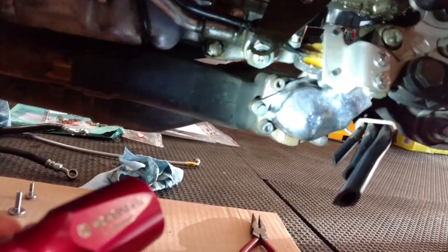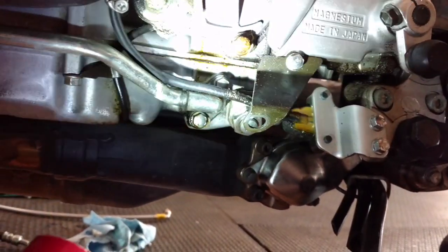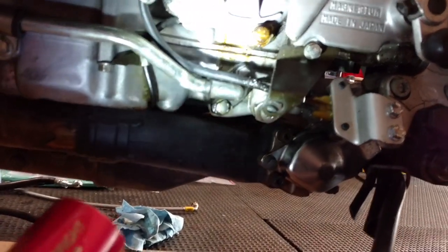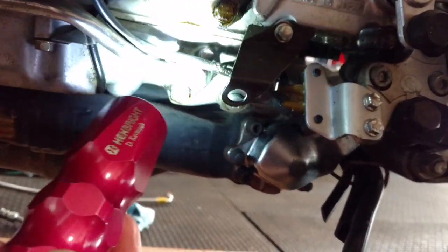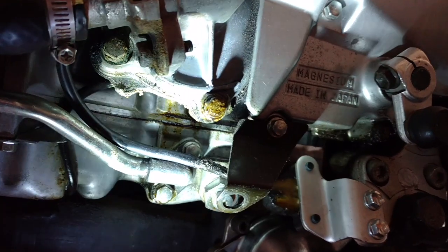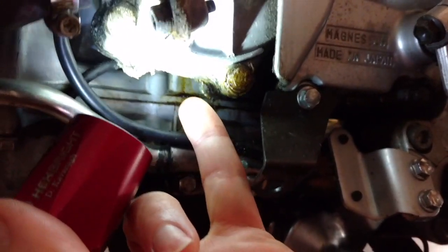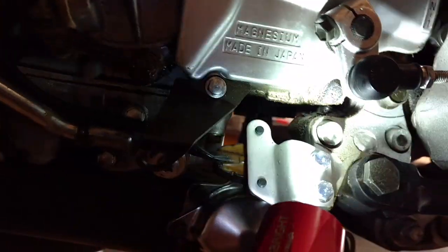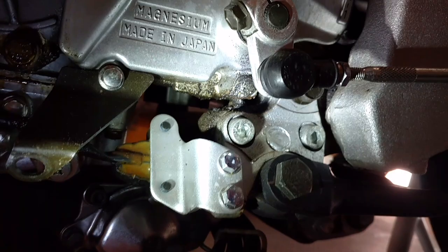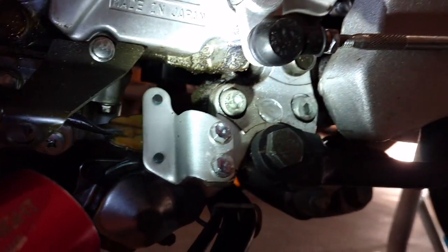There's that job done, and there's a sense of satisfaction that comes with actually getting something done. But now that I'm down here looking around, I can see there is some oil that's coming down from somewhere. There might be some gasket issues. I wasn't seeing anything above the water pump, so I'm not sure where that's coming from. You can see up in there there's some oil coming down, and maybe a little crud underneath the water pump. Over here I'm seeing some crud as well — that's where the chain is above there, so maybe that's just chain lube creeping down through there.